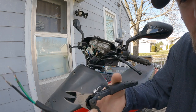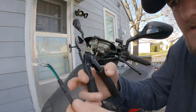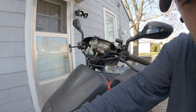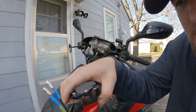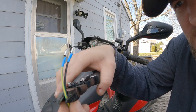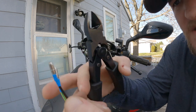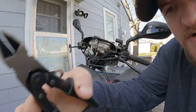I'm not going to cut it way up here, I'm just going to cut it down here so I have plenty of wire to work with. I've got the new brake switch here and I'm just going to cut them about two inches from the connectors. I'm not going to need these old connectors — I'll probably end up throwing them away.